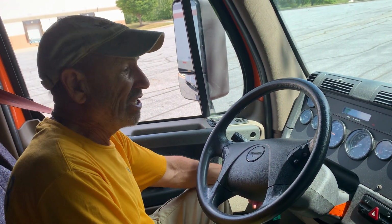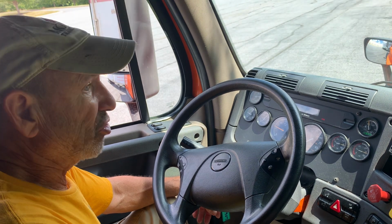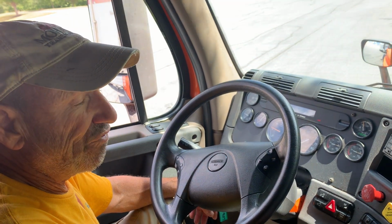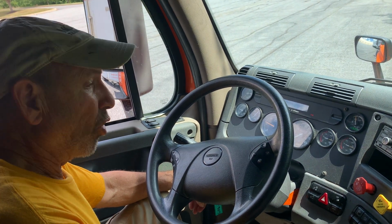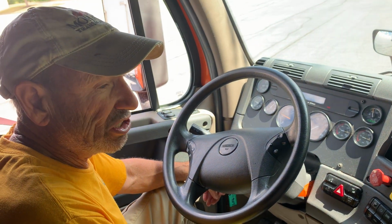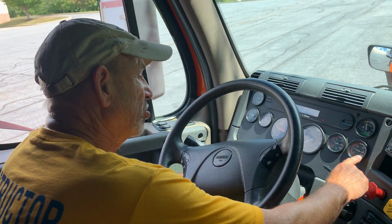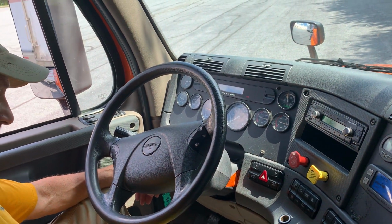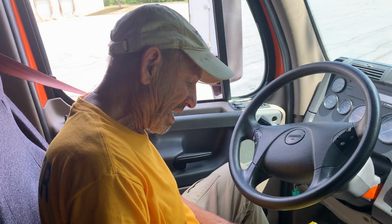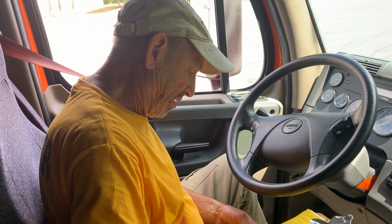I'm going to check my gauges. My oil pressure gauge should be reading between 30 and 75 psi. Temperature gauge, 160 to 200 degrees Fahrenheit. My voltage is between 12 and 14 volts. My air pressure is now reading 120 max in both gauges. And I'll come back to my check-off list and check them off. I did all that. That's good.